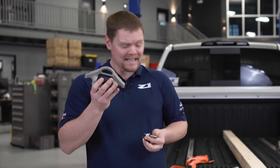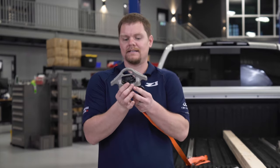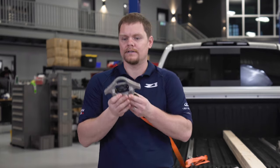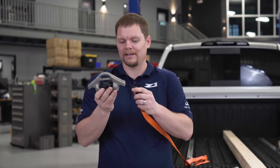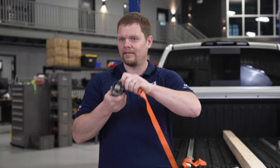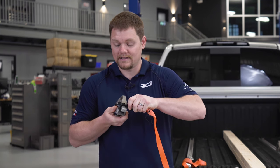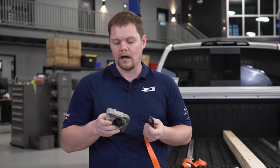A few of the other things I learned were that while this OE cleat technically has three tie-down options, I've never been willing to use the side ones because when you connect a ratchet strap to those, it very easily slides off. Once you apply enough force it starts to hold, but even then slipping it off is not too difficult. So I was afraid my load would shift or I'd hit a speed bump or pothole and it would simply come loose. I was always using the top hole.